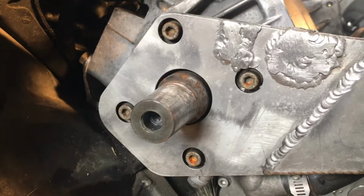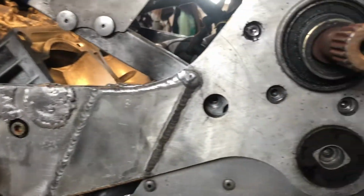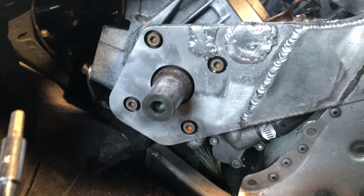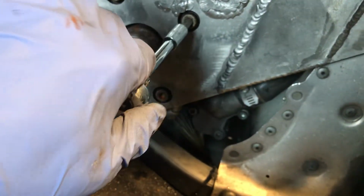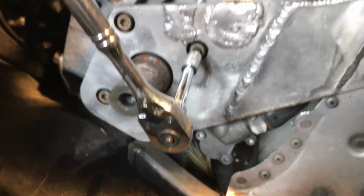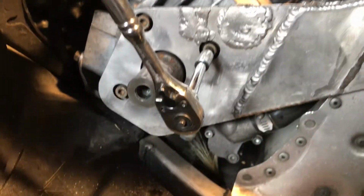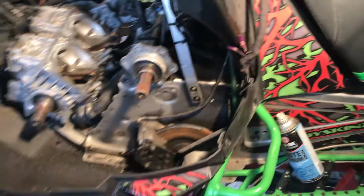I just gotta get these ones off. Took those two out. And I can take the clutch shroud off, and that crossbar. The ones that go into the crank are a 9mm. Probably have to heat them up. I put Loctite on them. Give them a little tap with a hammer when the socket's in it to loosen them up. Well, I got all the bolts and screws out. Take that off.